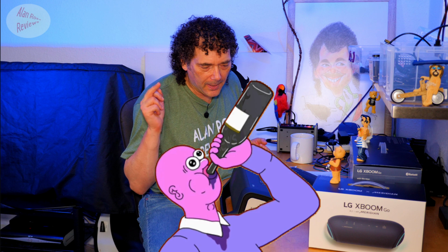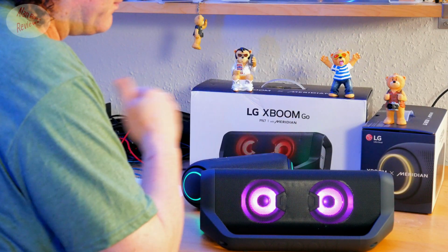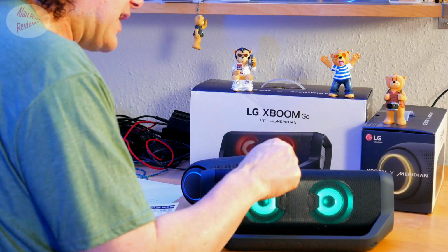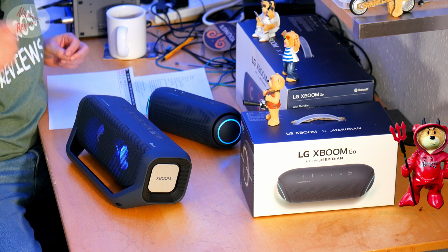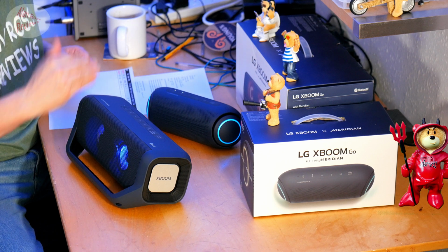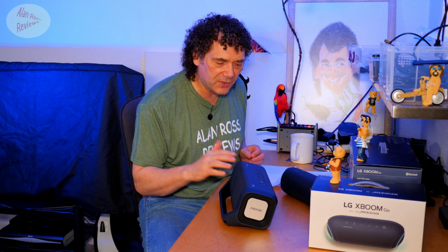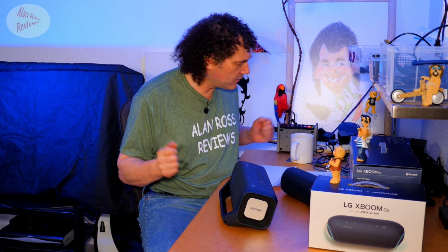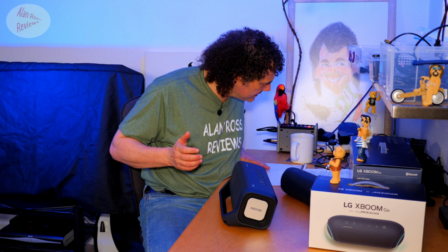I don't know why, but it does mean on this sound boost mode is actually less of a peak than you've got with standard mode, but DTS has the highest 11 kilohertz peak of all. And sound boost does have that bigger upper bass. So you've got more punch, but less deep bass with sound boost mode, but it goes louder altogether. Well, that was at around 60%. Let's do it again, about what I'm calling 80%, but I'm volume matching them.